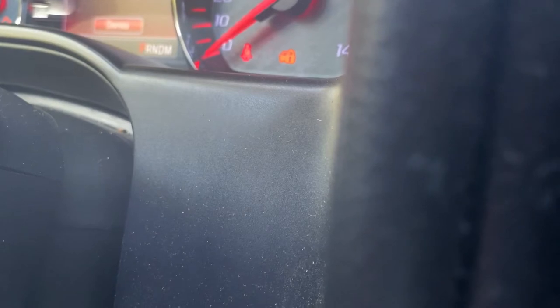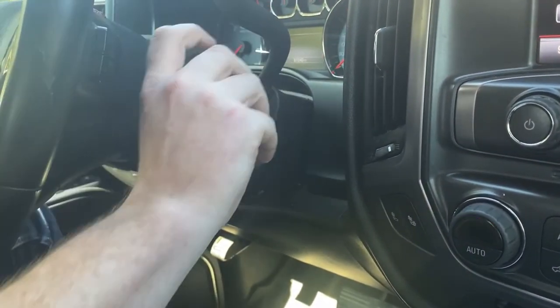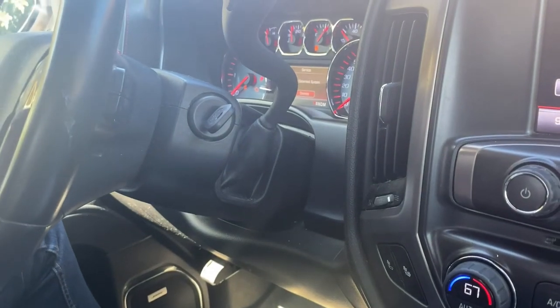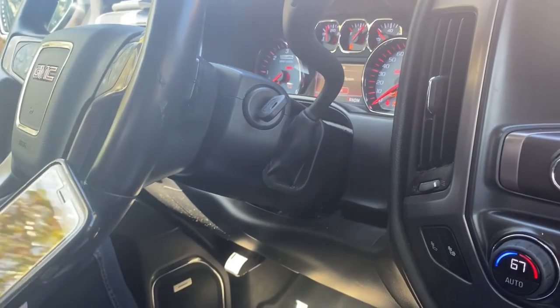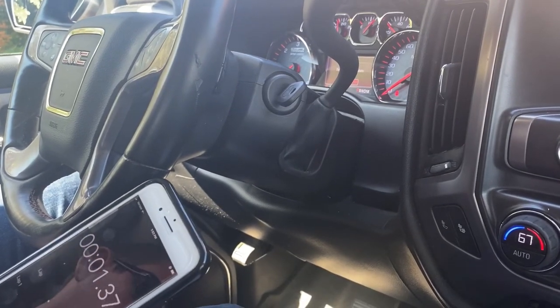So we're getting close to our 10-minute mark — we're actually at 9:50. We're just going to keep an eye on this security light here, waiting for that to go out. As you saw there, it just turned off. So now you want to take your ignition and turn it to off, then turn it back to on and leave it on, and we're going to do the exact same thing. We'll go ahead and reset our timer and we'll see you in another 10 minutes.